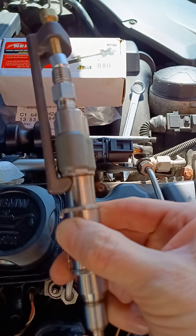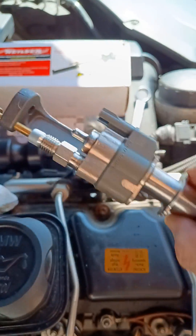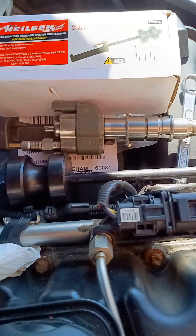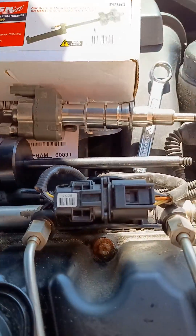Then I've used this clamp remover, a fuel injector remover, which clamps on there. There's a slide hammer you can use to pull it out. It actually came loose once I put the clamp on and started to use a bit of force — didn't even need the hammer.